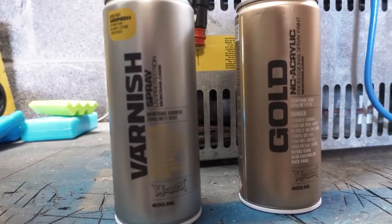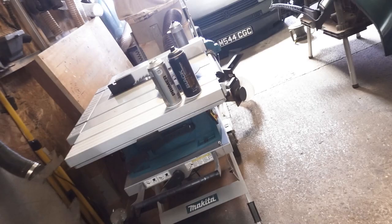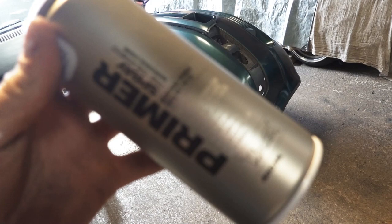What we're doing with the bumpers is we've got their plastic primer which we're going to be using here. I've just keyed up all the paint and given it a good key, then a couple of coats of the primer spray, and then I'm going to go over with their matte black range. Let's see how that turns out.